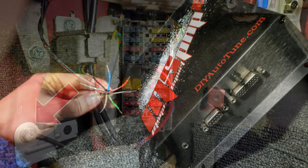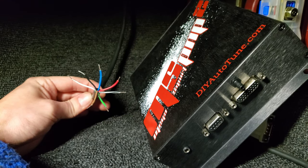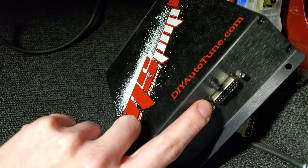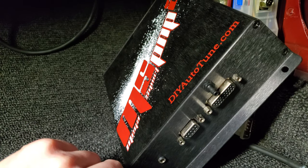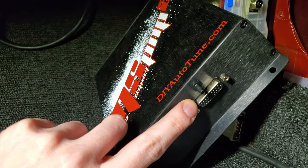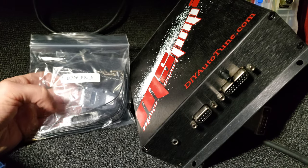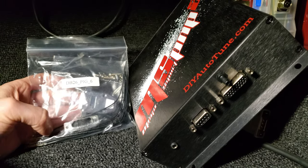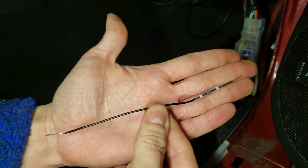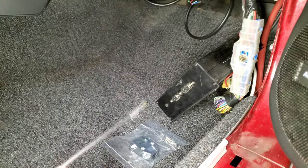Our air fuel ratio gauge was wired in a little bit differently since we needed to feed its sensor data into our Megasquirt ECU. The plug and play variant of the DIY Auto-Tune Megasquirt has a 26-pin port on the back for pinning in data, powering, and even grounding accessories that you might add to your Megasquirt. They even provide the necessary DIY connector and pigtail wiring already pinned out to make adding accessories even easier. We only ended up videoing the full process of one of these wires for our AFR getting pinned into the connector, but it's the same process for all of them.